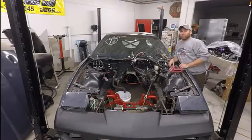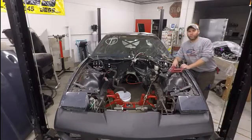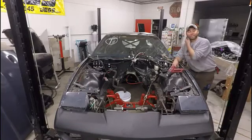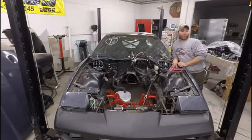I just found my issue with my dome sensor. I was having spikes that were going from anywhere from 0 up to 80, which is the max for the dome sensor. The reason that's important is because if you're not getting good information back to the ECU, then how is it going to output any information or tell your ECU to do certain things, such as like a safety, which in my case might have played a role into why I windowed the block.